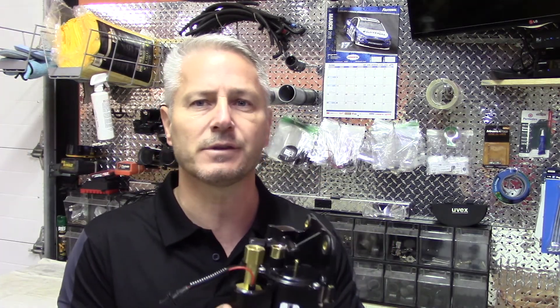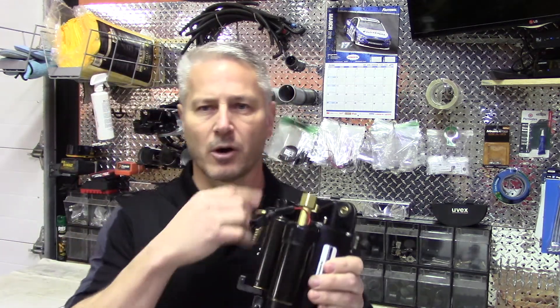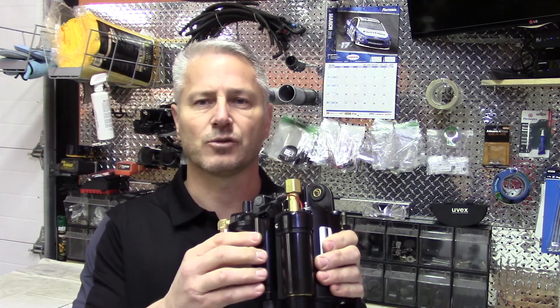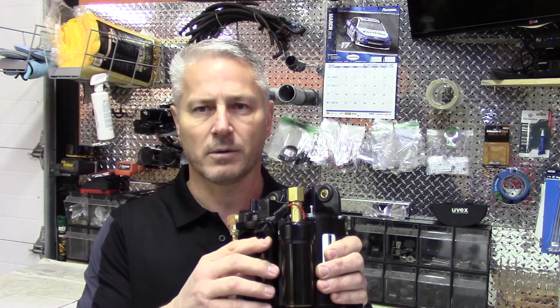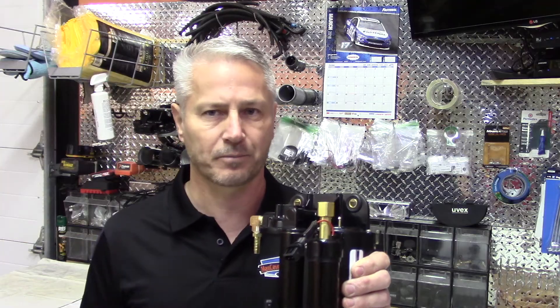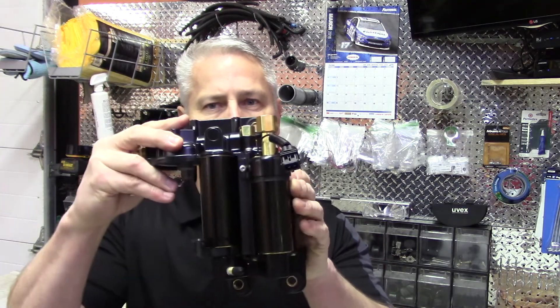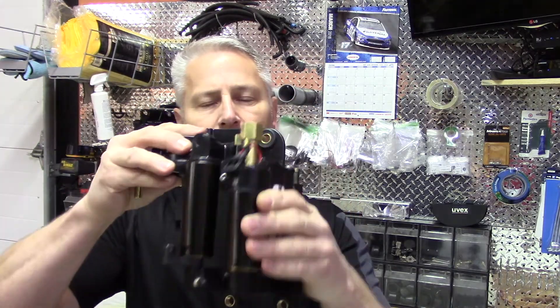I offer service to correct this. I'll strip out all the paint out of this fuel cell, test your low and high pressure pumps, clean the screens, flush them out, as well as change the O-rings as needed in the fuel pump. I'll also paint it as needed. This is one that's already been done — you can see it cleaned out the paint there. It looks brand new.